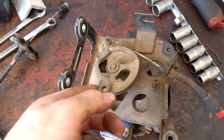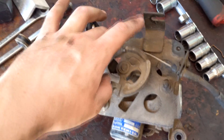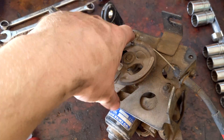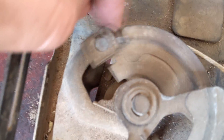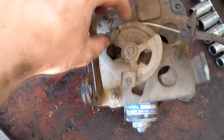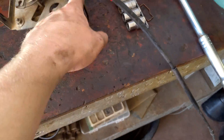Because this one doesn't lock the pedal and this one does, in order to get this to work we need to actually use the injection pump side, which is the locking side - the actuator side. You can see the little actuator assembly here. This is actually the actuator rod, and that pushes on this arm when it locks it, and we'll lock this at certain speeds. So we're going to have to route that inside the car and then join that to the pedal.